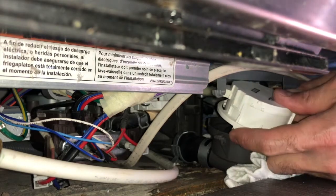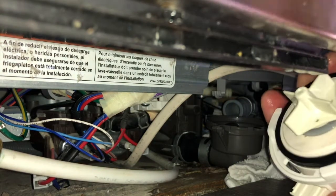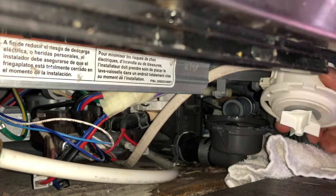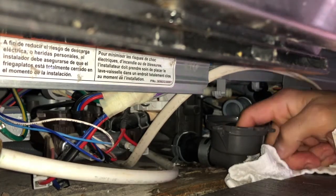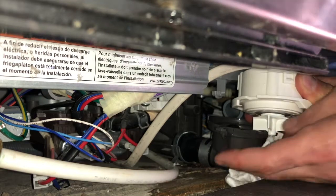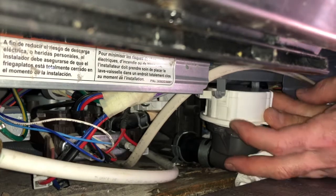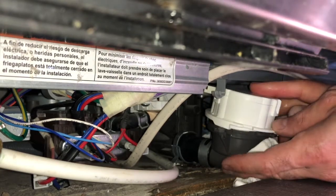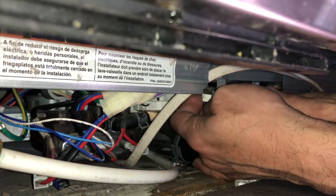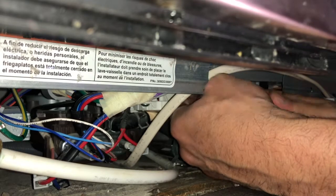You can take the whole thing apart if you want — if you're a first-timer, go ahead and do that. But I don't want to spend two hours. Got the pump out — this is the pump right here, that's what spins. Now I'm putting the new one in. Make sure there's no dirt in there. I had a piece of glass in there once. Now that's on there — I'm going to twist it on and make sure it locks in.